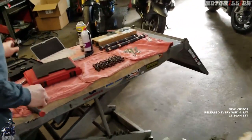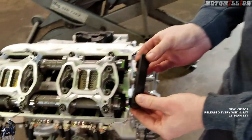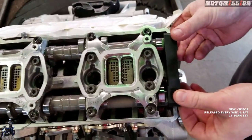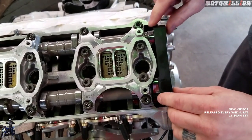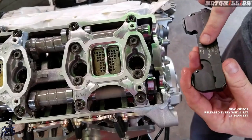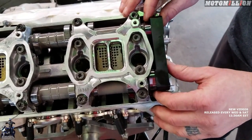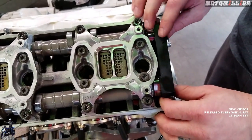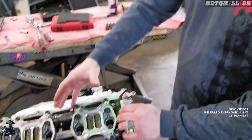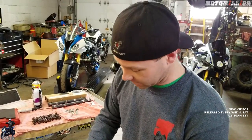The other tool I showed — I call it the eyeglasses — actually goes over on this side and slides right onto the camshaft. There are two flats, these flats all align, it's at zero degrees, so our cam chain isn't stretched and our timing is set perfectly from the factory. This is how we're going to reset it once we remove the camshafts. This is very important, because if you get this wrong, a valve will wind up hitting the piston and that causes expensive and extensive engine damage.